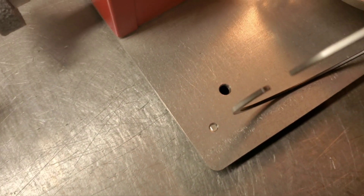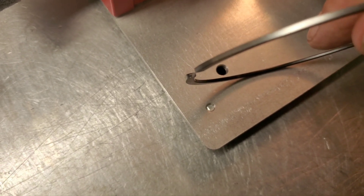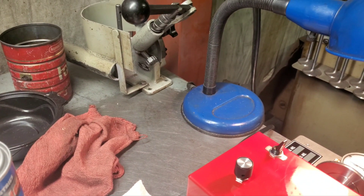The other side has not been touched. You guys doing race motors, especially guys with boost or nitrous — if you gap one side of your rings, then in the event you pull your motor down and do an inspection or ring check, you can see if those rings butted. Because you know that when you did it, you only ground one side. So that's one little tip: you can see if your rings are too tight. If they butt and you know you only ground one side, you know you need to take a little more off the rings.